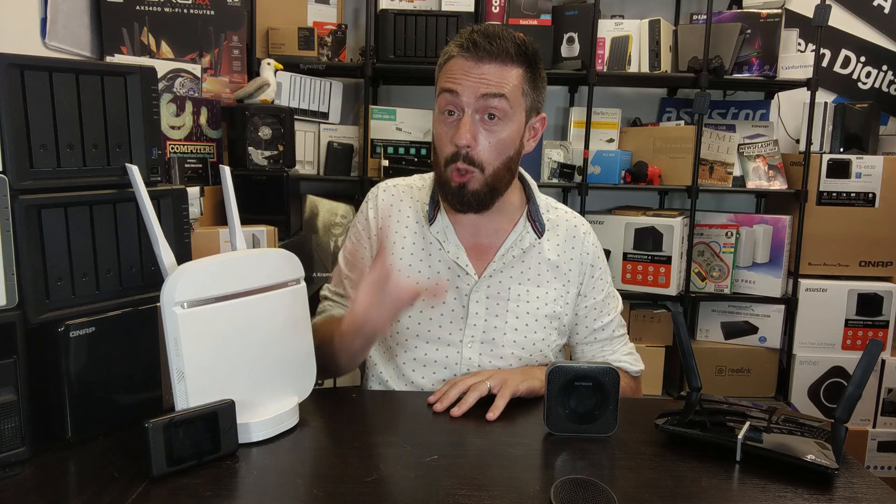It's really important because cheap SIM routers on the market often only support 2.4GHz — you see this with IP cameras around the home. A lot of routers support both; they are dual-band, 2.4GHz and 5GHz. The thing is, 2.4GHz transmits less data per connection. Even if you're using a new iPhone or Google Pixel that supports both frequencies — and this doesn't even account for Wi-Fi 6 or Wi-Fi 6E up to 6GHz — cheap SIM routers bottleneck your performance. Make sure it's dual-band or at least 5GHz.